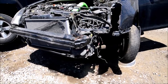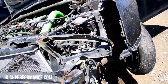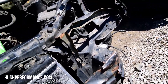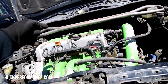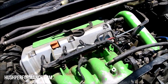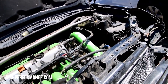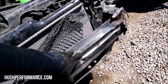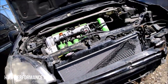When doing one of these swaps using AC, the idler pulley is something people want, so I'll grab that. I couldn't see the engine code to tell if they swapped in a K24 or K20A2. Motors and transmissions that look like they've been messed with - we take extreme caution. Looking at all this rust that developed in the crashed areas, this thing could have been crashed already before it came in. My suspicion is it was turboed, maybe the motor's blown, they put this one in and put it back to stock to try to sell it, and then maybe that person sold it to the yard.